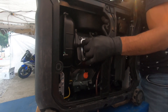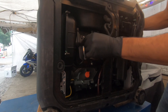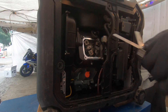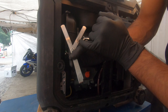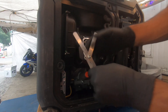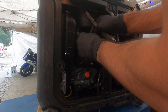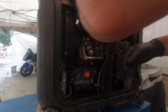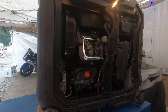What I'm gonna do is turn the engine to top dead center — you're gonna pull the cord slowly. On the exhaust side you check it with your feeler gauge at 0.007 inches or 0.18mm, and for the intake it's 0.005 inches or 0.13mm. Exhaust side first for me — put it right here where the gap on the valve should be, and this one is actually okay. Checking the intake — intake is also perfect.